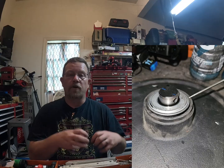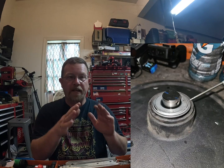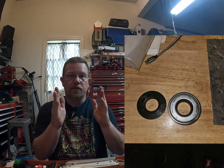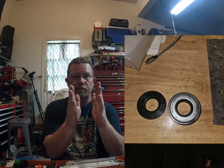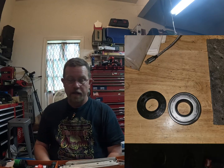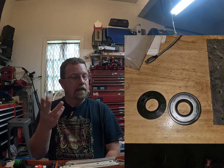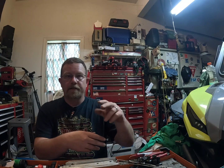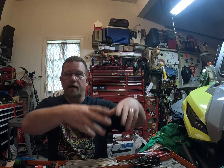You're going to see the dust caps on both sides of the idlers. You can reuse these — don't beat the hell out of them and just start ripping on them. When they get sandwiched in there by your idler arms, they help keep anything from getting in there. If you get the other one — the little black one in the picture — you've got all that room between the idler and stuff that's going to cause problems. Do everything you can to just gently pry it up. Take some WD-40 around the shaft of the axle, lube it up, gently work it around, then take screwdrivers on each side and just walk it up. You'll see in the pictures.